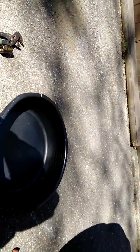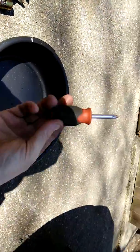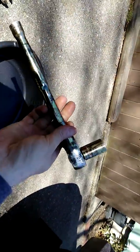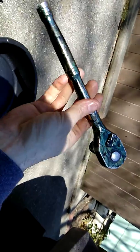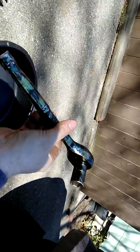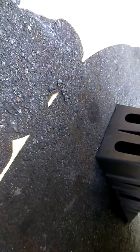Today we're doing an oil change for a 2012 Honda Civic. What you're going to need is one of these pans, a little screwdriver, and an 11/16th socket and wrench. You're going to get underneath the car and there's going to be a little metal panel that you'll have to take out four screws from — those four little screws look like this.